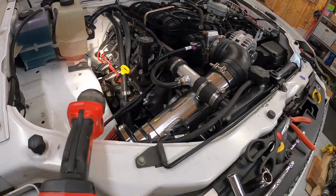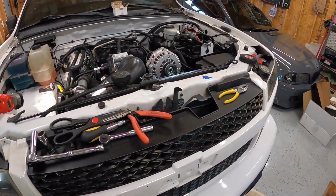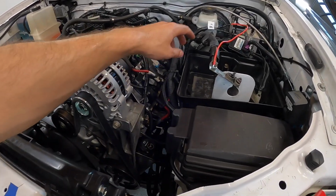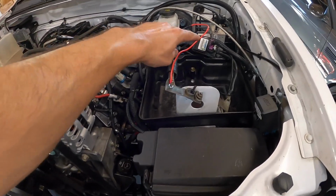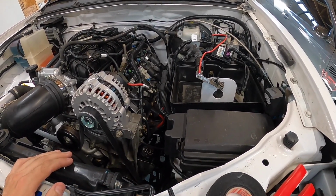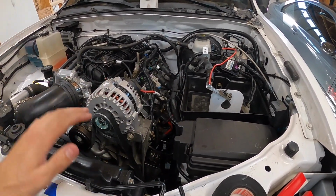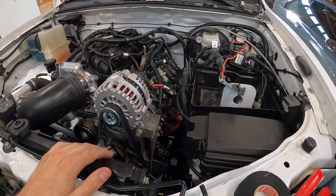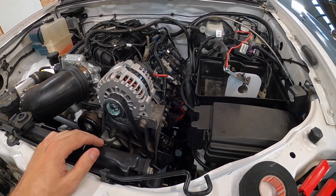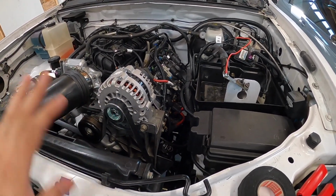The only things that you have to know when you're buying the Current harness is that you have to reuse the factory Colorado battery harness, which has the BCM in it. So make sure to keep that. You have to reuse that. I mentioned the wiring to the starter, so you have to extend that wire. And then you have to wire up the fans, and that's pretty much it. Outside of that, the Current harness does everything.